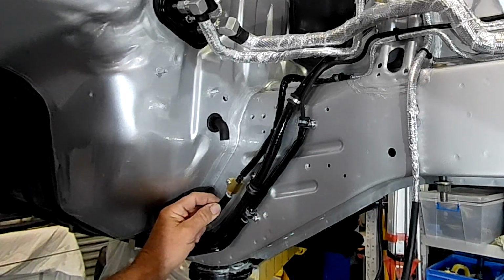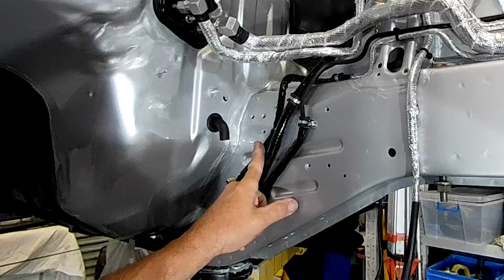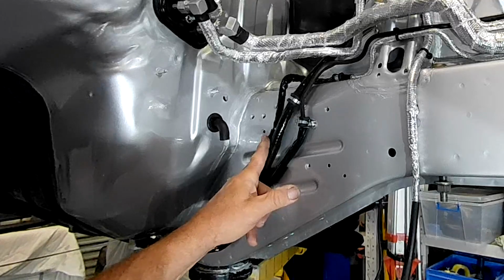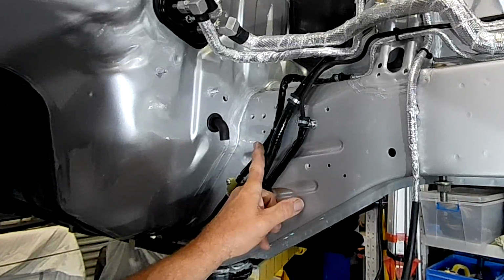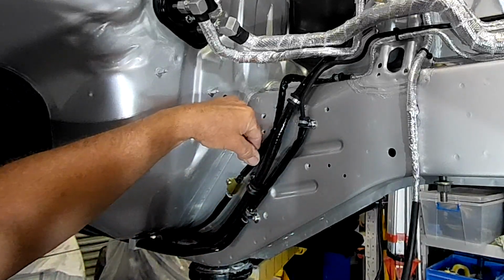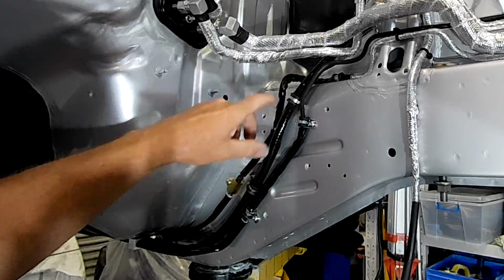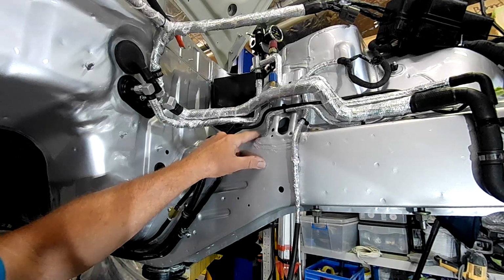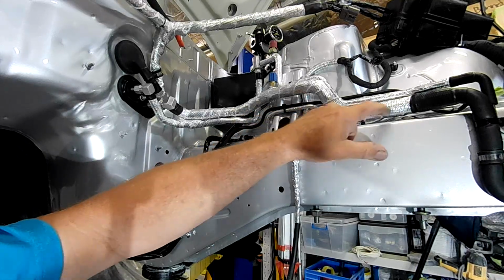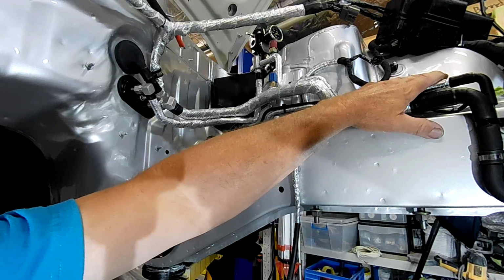It's got a layer of silicon coated fiberglass again, and then once we go up here, we go into that line that we were doing on the bench there that you guys would have seen. So it has a coat of black epoxy paint on it first, then it has that really thick 4:1 heat shrink, and then it has a layer of, yes, you guessed it, silicon coated fiberglass sleeving in this worst area up to here on this point, and then up here we go back to our standard wrap over the top of the heat shrink, which goes all the way through to where we go through this penetration for it in the front inner guard there.